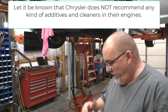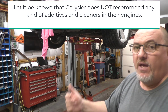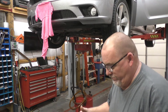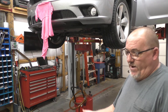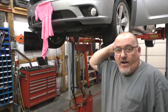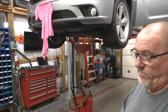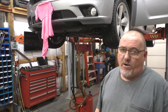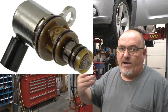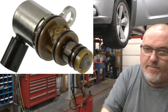I'll recommend to the customer that before the next oil change we put a little Seafoam or something like that in it to let it circulate before we drain it. That's where we're at — I wanted to share this in case you get that code, so you have a basic idea of what it does and why it sets. If you're checking solenoids at home, you can do it by putting power and ground to them and see if they open and close. There are also screens around them that can get clogged.